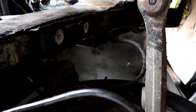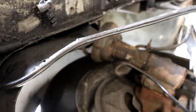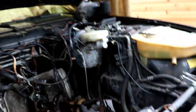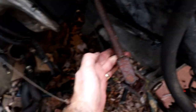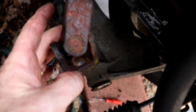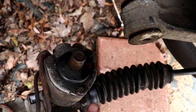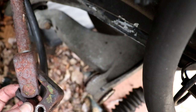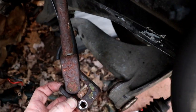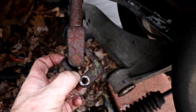All this is going to get cleaned up — new manual rack. I'm also going to switch out the control arms, new bushings for all this stuff. I'm going to go with stainless steel brake lines, switching out the shocks — I haven't decided which suspension system I'm going with yet. To get the rack out, you also need to get the steering assembly out of the way — it's just one bolt, this slides down, you can see how it's threaded. It just sits down on top and one 10mm bolt holds it in. The biggest thing is to put these bolts in a bag and tag them quickly before you lose track of what they are.